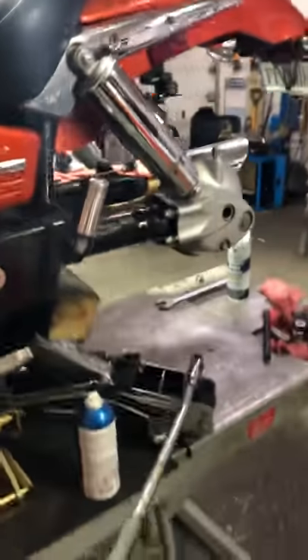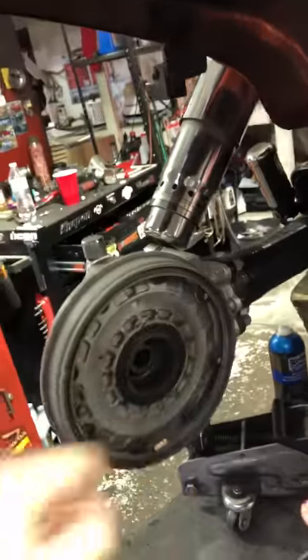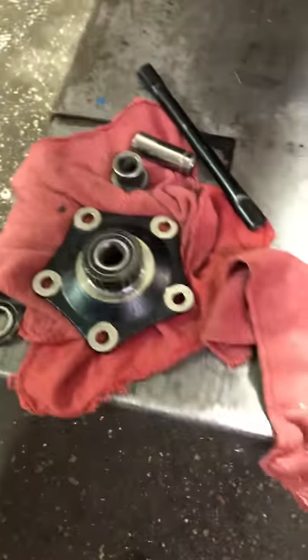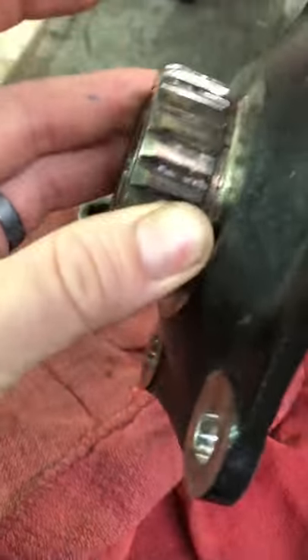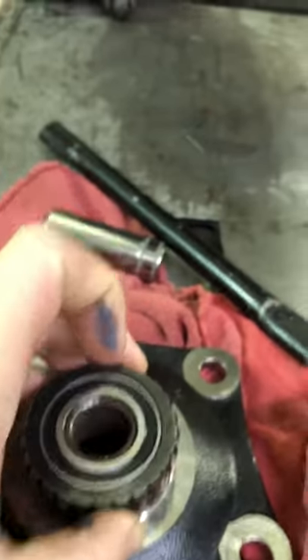Servicing the coupler is required obviously, but I want to show you guys exactly what that looks like. It's not gonna be a long video, but something I'm fixing now on a VTX 1800. So you have your rear wheel — the coupler goes into your final drive and all this stuff should be nice and lubed up with the ever-popular moly paste, molybdenum disulfide, whatever you want to call it. A real service to this coupler is not just putting a paintbrush inside your moly and coating these splines. Yes, these need to be coated very well because they wear out and look like crap when they're worn.